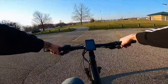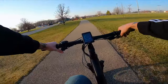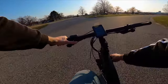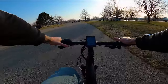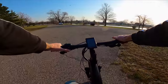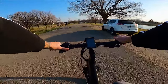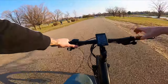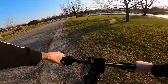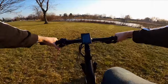It does have a shock lockout here. When locked, the shocks won't compress — that's what you want for pavement to keep from losing power. When open, the shocks can compress and dampen impacts from bumpy roads. Typically when riding on pavement you leave it locked out; if you want to go off-road, switch it to open so the shocks have some bounce and handle those bumps better.